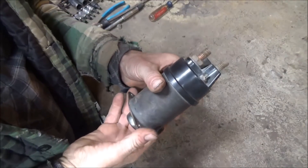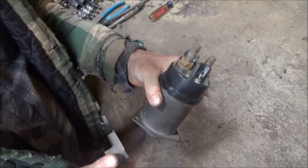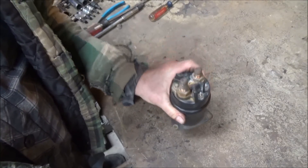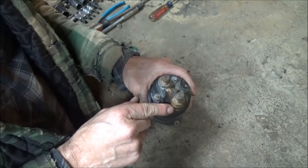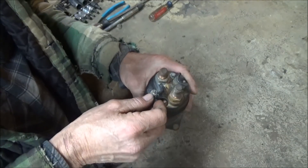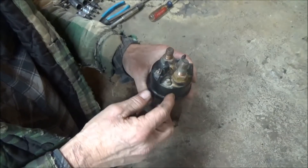This video is about what is going on inside of a starter solenoid. This one is on a big truck, but it's the same principle as what's on a car, a lawnmower, or anything that needs a starter solenoid or relay. The reason you need a relay on a starter is because a starter pulls a lot of amperage. Amperage needs heavy wiring and heavy contacts. When you use a lot of amperage, voltage doesn't need to be heavy, but amperage does. So when you have high amperage, you're going to have great big bolts like this.